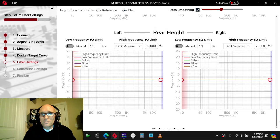I checked the levels as well on the mini DSP. You can check the gain levels on the mini DSP, the input and the output. It gets up to around -8, right? Zero is full peak. So -8, it's close, but we're not clipping, right? The input as well from the receiver to the mini DSP, it's not causing these to clip. So we are, I wouldn't say we're far away from clipping, but Tenet is the loudest bass.